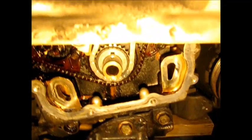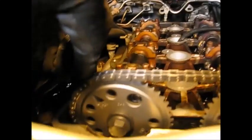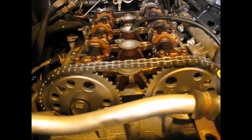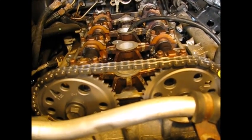Okay, so I'm just going over this one more time — everything's in order. Here's our crank, here's our blue — a similar colored chain link on the white mark. We're at noon on here, 12 o'clock, our starting position. Now on the intake sprocket we're lined up at about two o'clock, and on the exhaust sprocket at ten o'clock. One more observation on these timing marks on the crankshaft and camshaft sprockets.